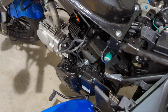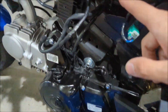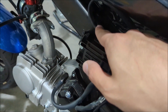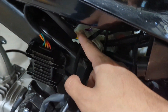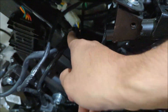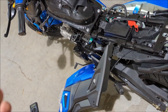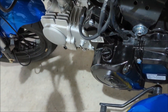If your bike is not charging, check the pins on the voltage regulator connector — trace the wire back there and make sure the pins are straight. You can also check the alternator/stator connector pins to make sure they're straight. Note that this is a DC system but uses an AC alternator, and that works fine.